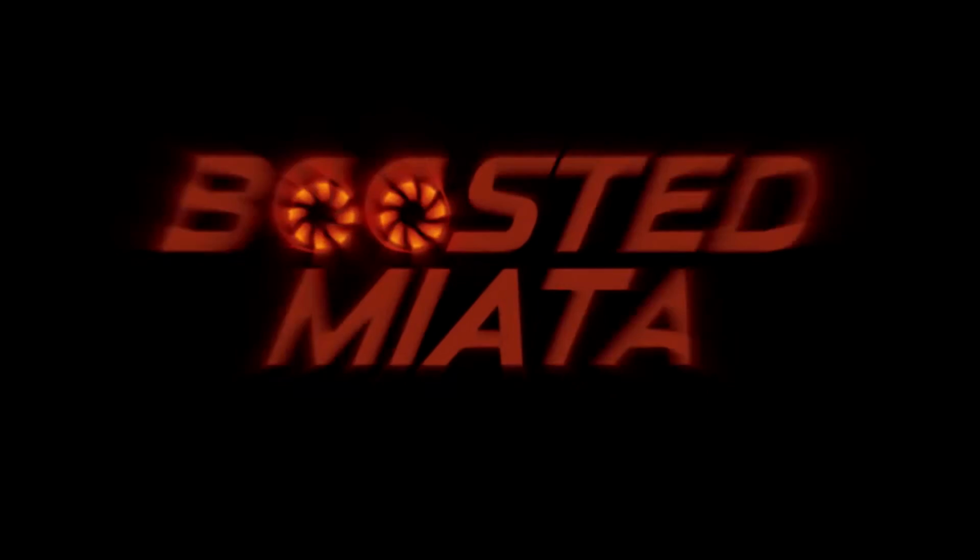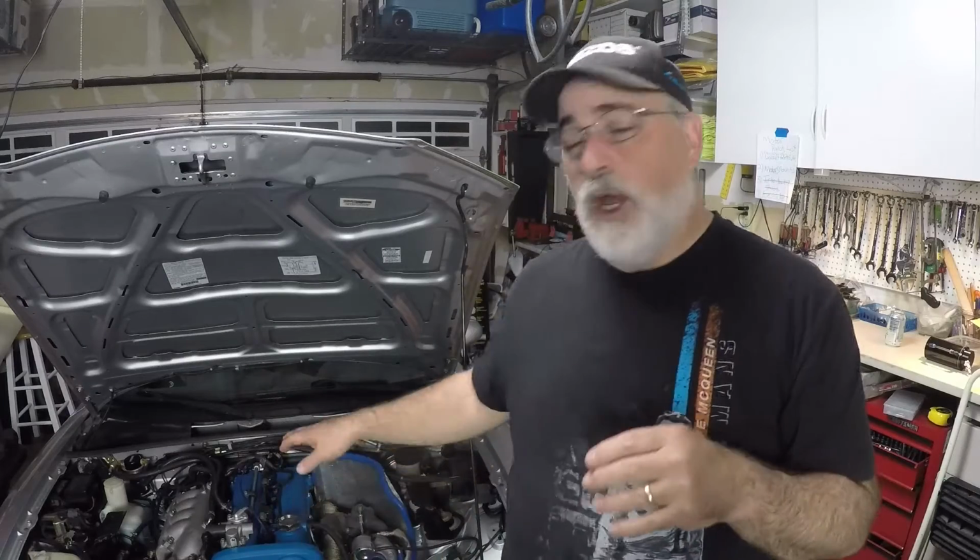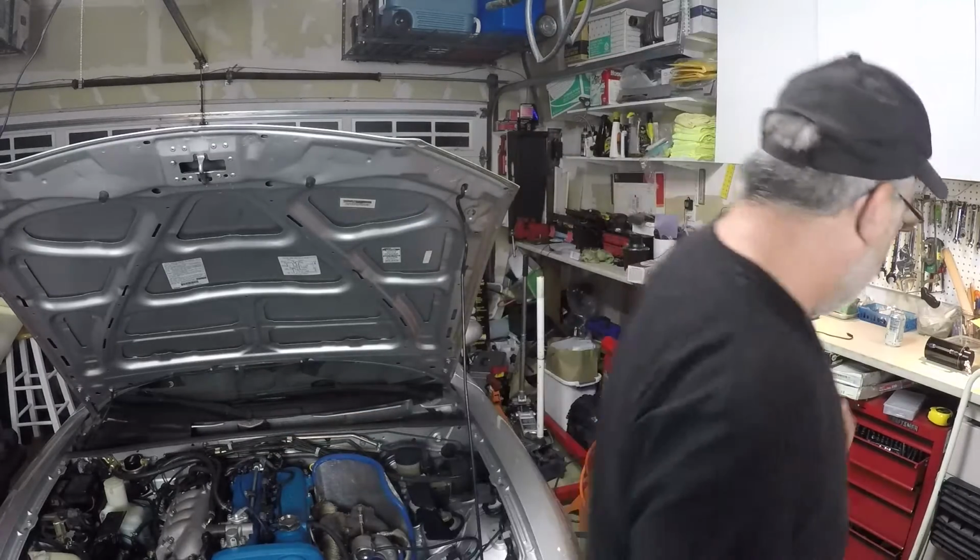Guess what? More oil leaks. Let's check it out. Well, I've got more oil problems with the Miata, but this time it's not so bad. It's being caused by my turbo, actually. It's being caused because the turbo is creating so much pressure in the engine. It's blowing oil out where normally just vapors from the motor come out, actually right from the valve cover. So we have a fix for that, and it's called the catch can.